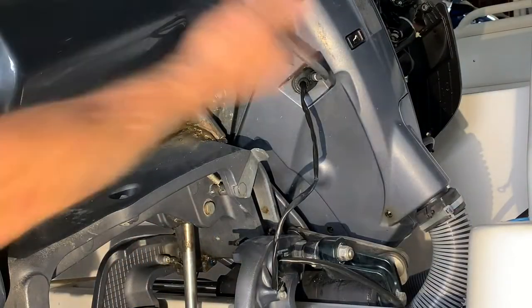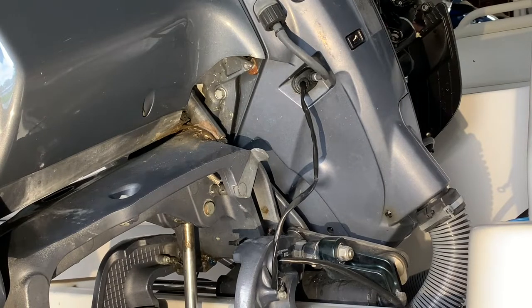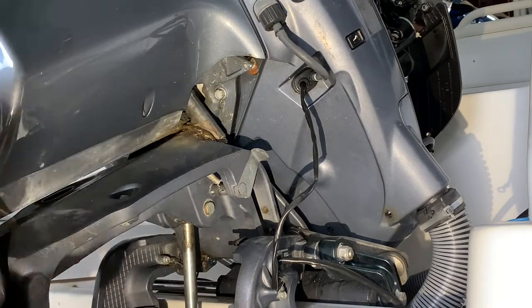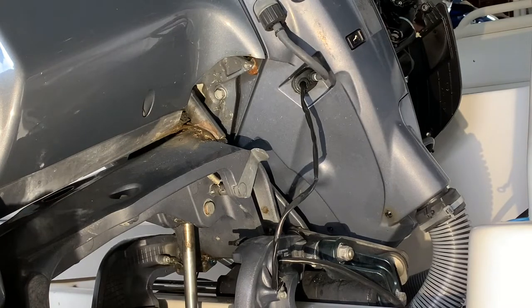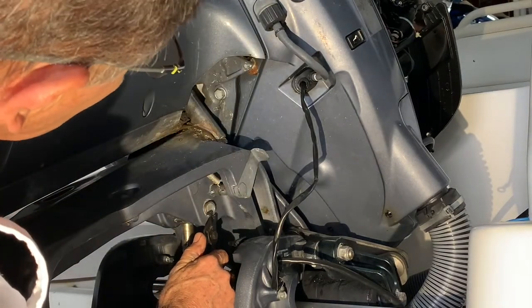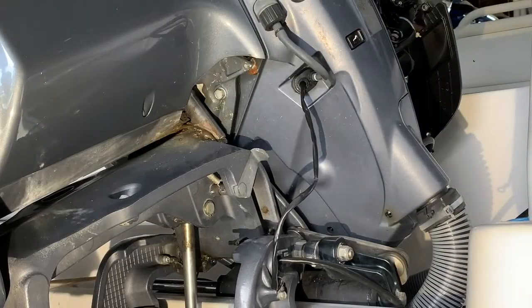Once the pin is in, you see the engine doesn't go all the way now, because the pin is in place. Now what's next? Next is this guy, the retainer holding that pin in place. Remember, little retainer. We're gonna put that retainer at the end, the flat side of the retainer to the outside, okay? The round side to the inside. Always the flat side of the retainers go to the outside. So let's put this baby in place, right in the groove, right there. I'm gonna push a little with my hands. There you go. Okay, retainer in place, done.